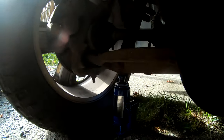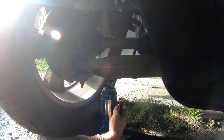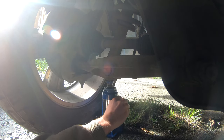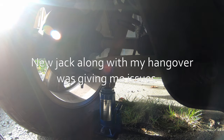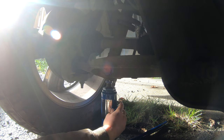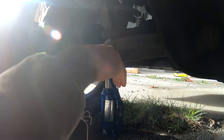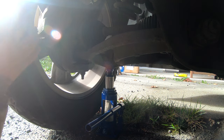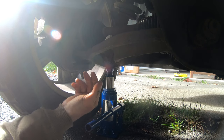What you want to do is put your bottle jack back underneath the lower control arm. We are now safely off the ground and we still have pressure on the lower control arm, which puts pressure on these ball joints and will hopefully reveal whether or not they're still good.